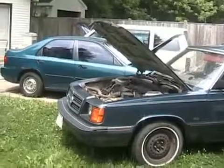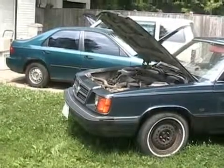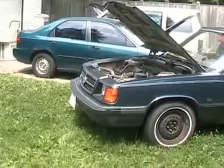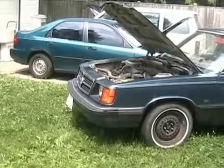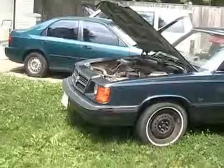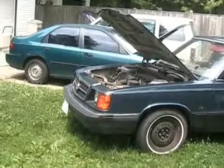One final thing, if you do manage to get a kit and you get it all working right, and you have a typical engine with a cast iron crankshaft, with a low volume, lower pressure oil pump, with weaker pistons like they come with stock that are made of cast aluminum, well, your engine probably won't last long. You'll damage the crankshaft, spin bearings, crack pistons, maybe even bend rods. It's almost a waste of time to build up an engine that isn't designed from the bottom end up.